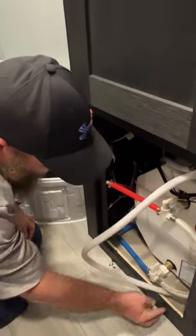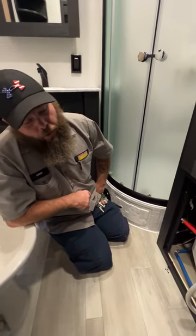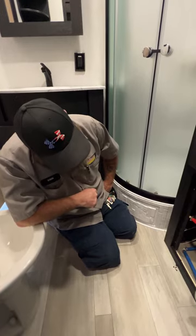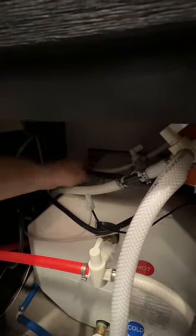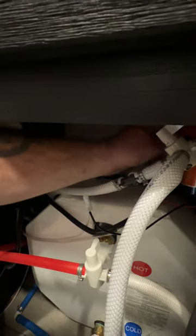There's a same-style knob located up here towards the top for this siphon tube, which you can stick into your jugs of antifreeze to winterize your coach. You could probably get by with roughly about two and a half to three gallons of antifreeze — but please don't quote me on that. They do have another valve down here as well, but that one had me a little confused because it ties into your water lines. I'm not 100% sure why you would shut that valve off, because all it's going to do is have your antifreeze just keep cycling around — honestly I think they should not have put that valve in there.